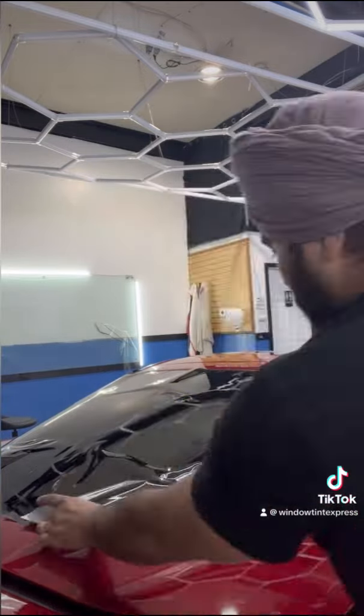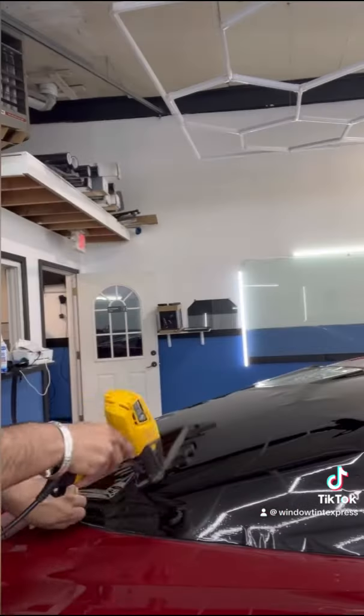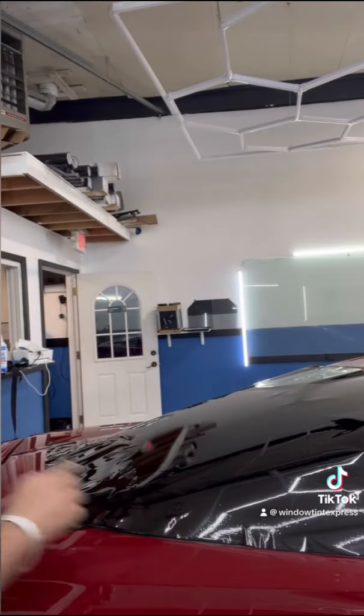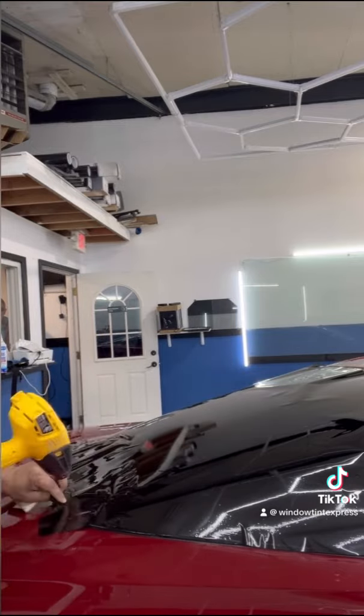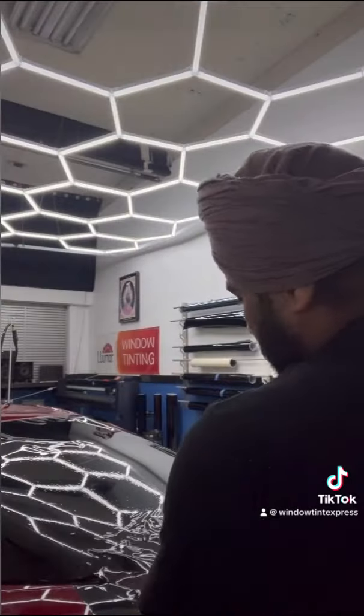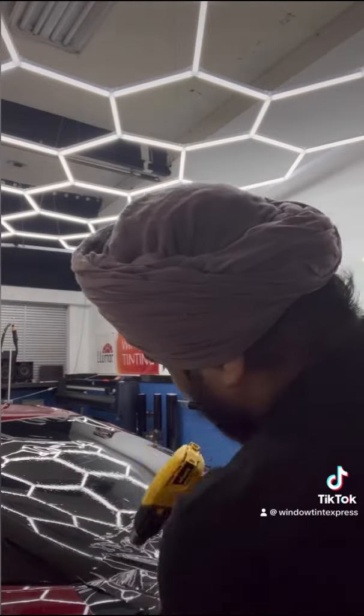My recommendation is to shrink the sides first, then shrink the middle, because the mirror area is the easiest part. You want to do the sides first because that's the hardest part to shrink. When it comes to the end, the film will not want to shrink — what you have to do is a pull shrink.